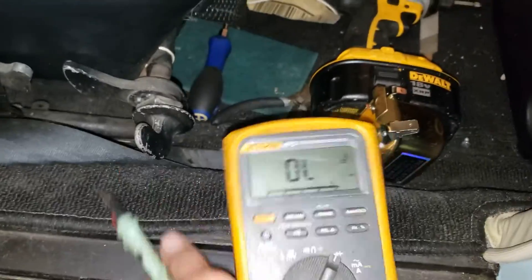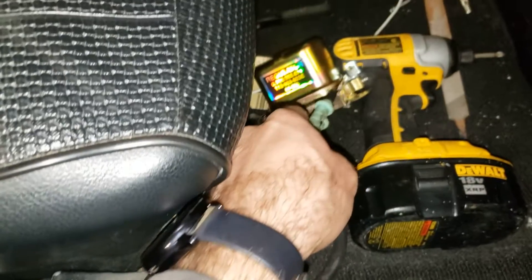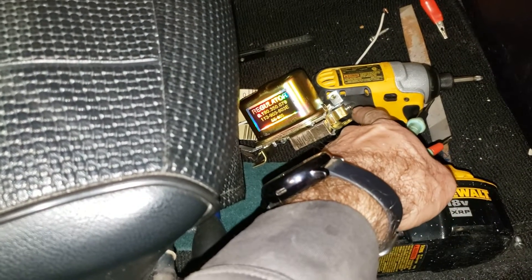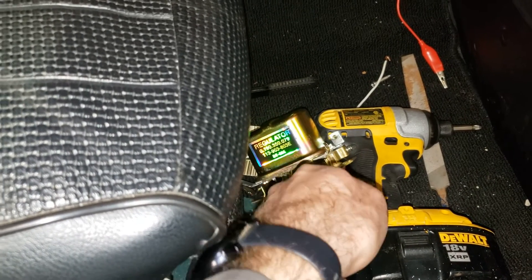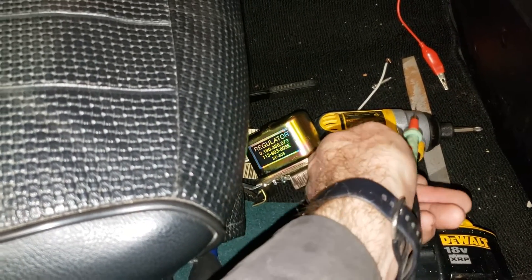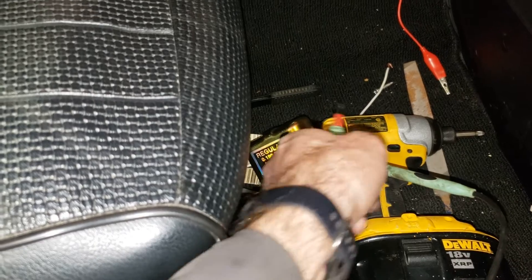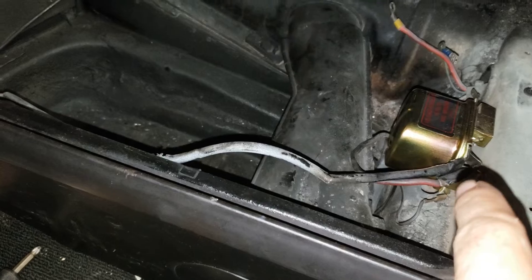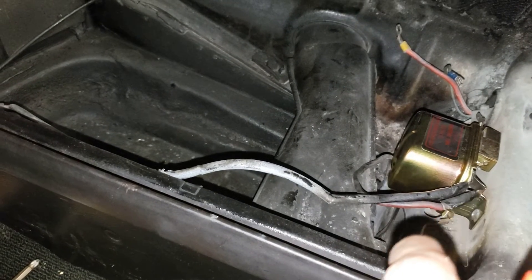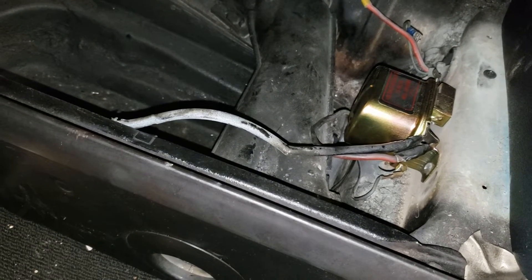The DF spade is on the same side as the lug — the screw lug where your D+ wire attaches. If we check from the DF spade to the case on a brand new regulator, we do have continuity. On the old one, we don't. That tells me the voltage regulator is bad. So I'm going to pull it out, swap in the new one, and we'll see if we can improve on our 0.7 volts of charging voltage while running.